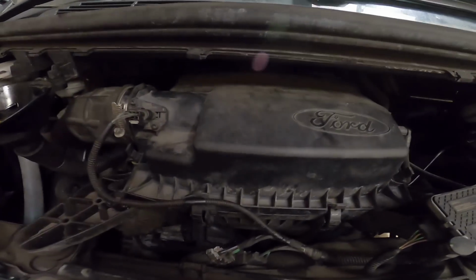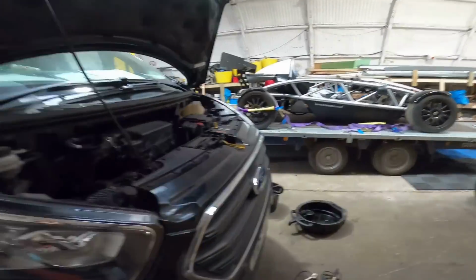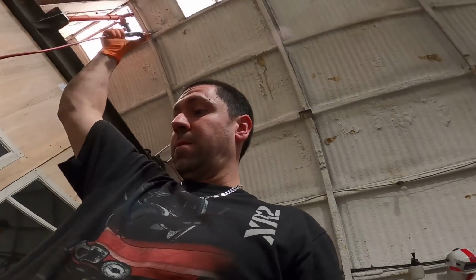Got the van all back together. Well, obviously apart from the wheels. It's all built up. The only thing I haven't done is coolant, but I want to make sure it runs. I've had the battery on charge, but where it sat for 8 months, the battery didn't really charge up. So I had my charger on supply to just add voltage to it as such. And that kind of worked for a bit, and then I changed it to recondition because I've got a couple of good chargers. But it's still not enough to crank it. It cranks, but just really slow. It sounds really flat.